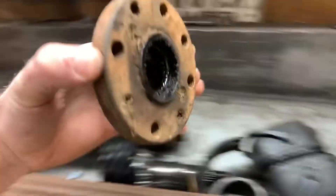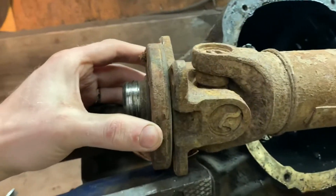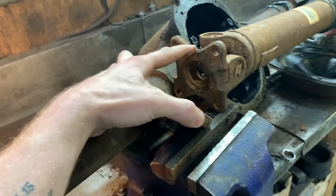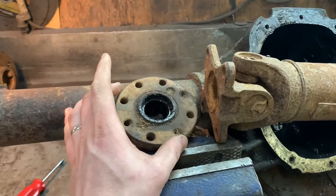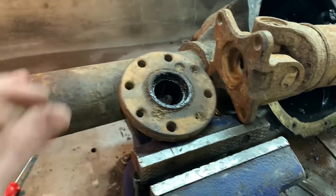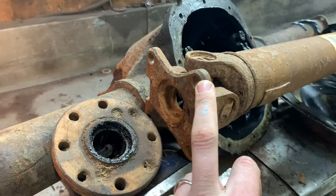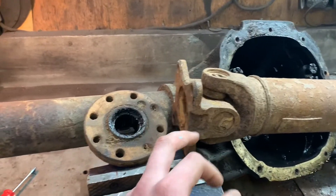Let's see if I can find this flange - oh no, it's too big. Looks like I'll have to buy a new flange for here, or a new flange for the pinion. I'm not sure if the Explorer or Ford trucks have the same pinion splines as the Mustang one, so I could just put the bigger flange on, or if I'll have to get the smaller drive shaft flange. I do have a Ford truck, like an '02, scrapped.